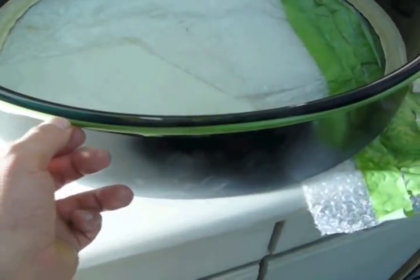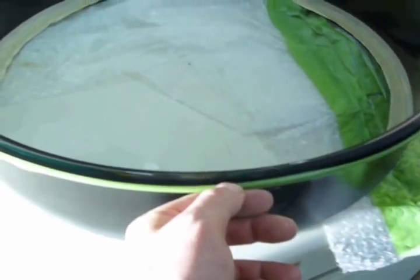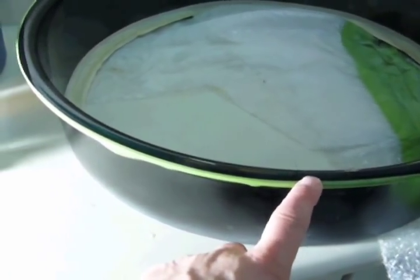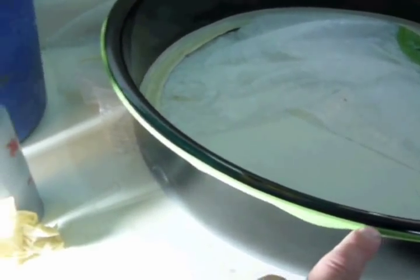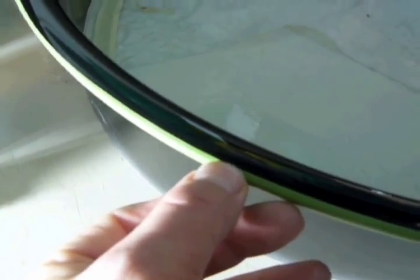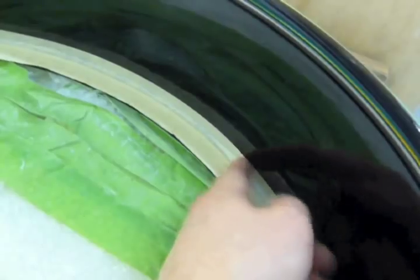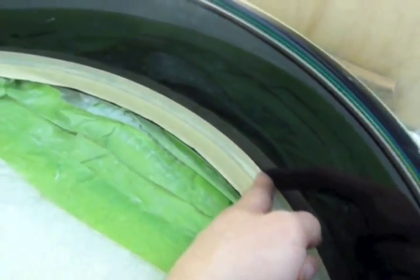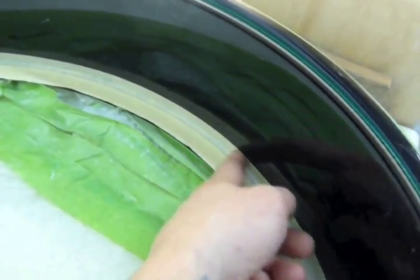First, I like to tape up to the edge, so I don't need to sand all the way at the edge, because then I'll have to buff on the edge. And that creates a danger of burning through on the edge. So, see, look, I have the tape right over the edge. And then right here, I have the tape going upwards so it's not all the way in the corner of the cavity and creating a problem when I have to buff it out.